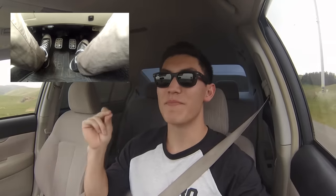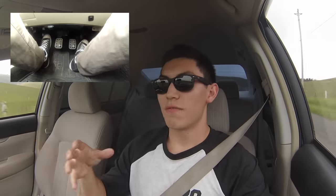Next, double clutching. Double clutching is a little weird. You don't really need to do it in cars with synchromesh gearboxes, but it definitely helps if you really need to pass someone immediately on the freeway. Let's say someone's doing 50 miles an hour in a 65 zone, and finally a spot opens up for you to pull past them. Well, if you floor it in fifth or sixth gear, nothing really happens. So you need to get it to a lower gear. Sometimes even fourth won't do it. So let's say you're in sixth gear and you need to put it in third. What do you do? It's kind of the same as rev matching, except instead of pushing the clutch in and revving while your clutch is in, you actually rev it while the car is in neutral. What this allows you to do is effectively turn your downshift into an upshift.